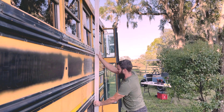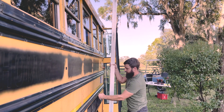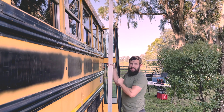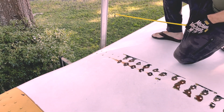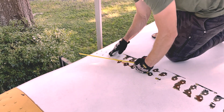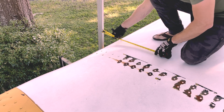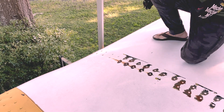There are instances where the rail won't contact on both expected points but will grab a different pair instead. If that occurs, you have to either split the difference or skip over that one and go to the next one. On the roof I'll show you how to resolve that. In this case we can't completely get over here because of the entrance, so we do our best — 22 inches is about the sweet spot. Mark the bus and move down to the next set of rivets.